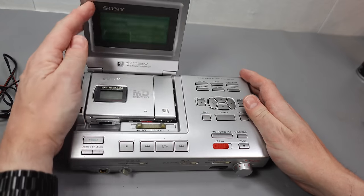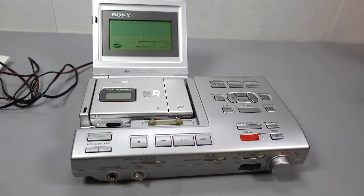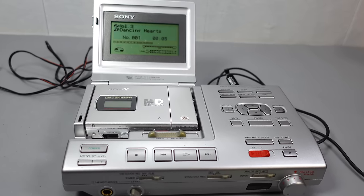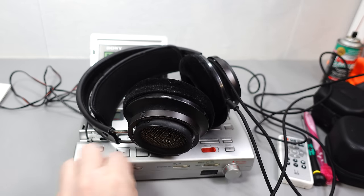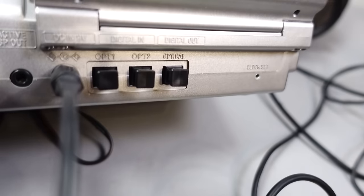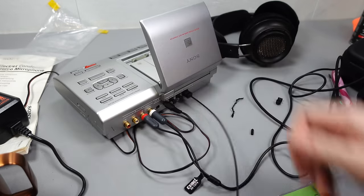After cleaning it up, putting it back together, attaching the power adapter and turning it on — it was looking good to start with. It turns on, can detect there's no disc inside, and after inserting a disc the machine reads the contents just fine. However, after plugging in my active speakers and pressing play, I'm not hearing anything. From the information on the screen it's clearly playing the disc — it's just there's no sound coming out of the rear RCA sockets. I then tried my headphones in the front socket and again there was no audio whatsoever. There's also another 3.5mm socket on the back but that was dead as well. With all the analog outputs dead, the only thing left to try was the digital one — and fortunately the audio was coming through just fine.